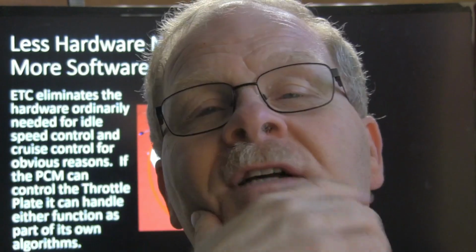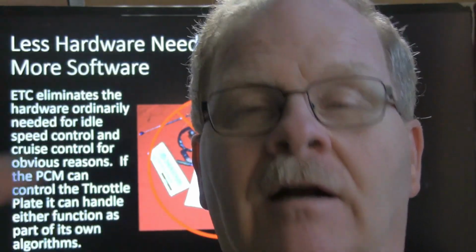The reason they sold it so cheap is nobody really wants one that doesn't have any accessories on it. But one of the things I wanted was cruise control. So I went in and I said, is there a cruise control kit for this truck? Because it has an electronic throttle body on it. They said, no, you can't get that. And so I investigated that, and I went and bought a $52 set of cruise control buttons, took the airbag off it, popped those buttons on there, plugged the wires into the airbag clock spring because there was a place to plug them in, and went over there.